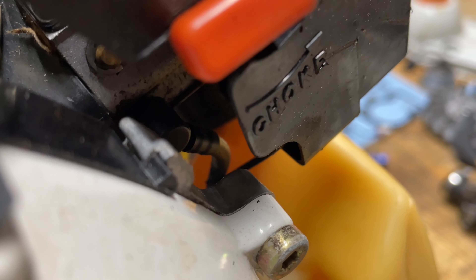So what do you do? I can get one bolt in here, but then it sits cockeyed like this, because it is hitting on this piece right here. So all I'm going to do is file this down some in order to get it to fit smoothly so that I can bolt this on, because I know how important it is to protect this fuel tank. I just did a quick angle grinder job there — not necessarily the prettiest, but in terms of a quick modification to make this work, I think everything lines up now. So let's bolt it on.